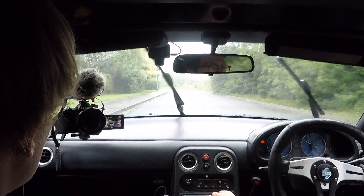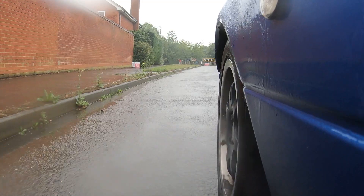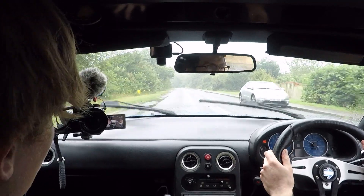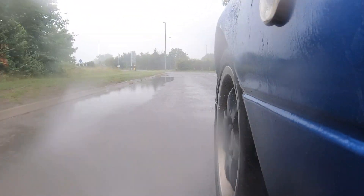So it's coming back on me - big straight. Yeah, that's your front. Interesting - maybe now that it's got hot. It's not bad - it's pretty good though, isn't it? Especially the road is covered in water at the moment. It brakes you forward. That was the rears - so your fronts are braking but also the rear's got a bit of axle-tramp. So rather than necessarily being your rears that are locking up, what I think is happening is your diff mounts are shagged. My diff mounts probably are shagged. Definitely axle-tramp in the back there. Some polybushes - some solid bushes in the back. So yeah, much more confidence-inspiring, especially when you come to corners. My commute to work is all back roads, so I can brake a little later than I thought I would. I can brake much harder and later now than I could before.